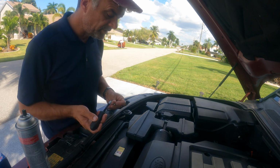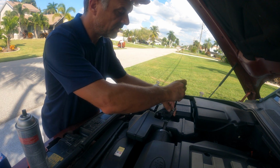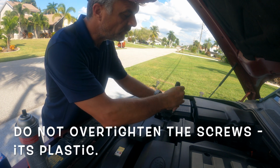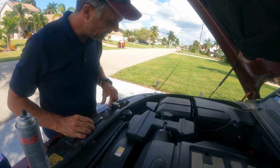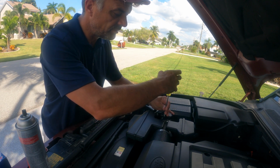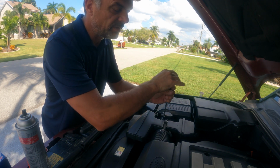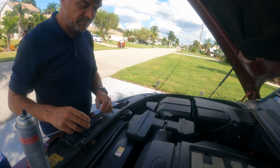In case you want to change the MAF sensor instead, I have the new MAF sensor here, and then it's just to do the same thing in reverse order. Basically start with the screws, and then after that you put in the plug, and you should be ready to go. Once you have all the stuff installed and sealed up, make sure there are no leaks on the intake either, because they'll create other malfunction codes for your computer. It's very sensitive, especially on a Land Rover. It can see everything from a leak at the oil filler cap to whatever else.